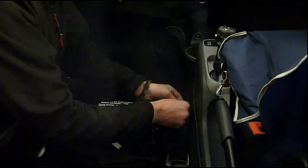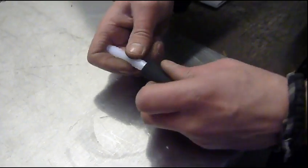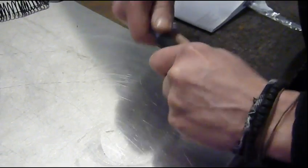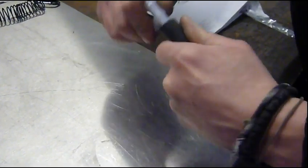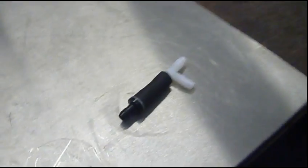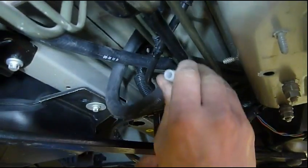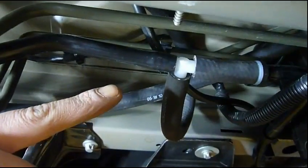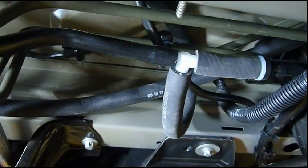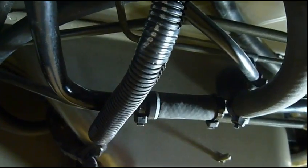Under the car, the rubber vacuum pipe is brought through a grommet in the battery box. Now we need to make up a vacuum line with check valve to allow the vacuum pump to T into the vehicle's vacuum servo line — see page 11 of the installation instructions for further detail. It is important that the check valve is correctly orientated and placed upstream, i.e. towards the engine inlet manifold from the T point.